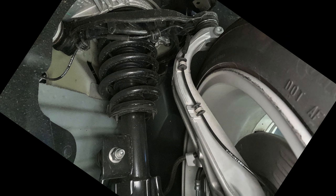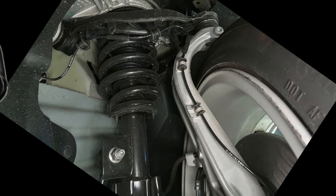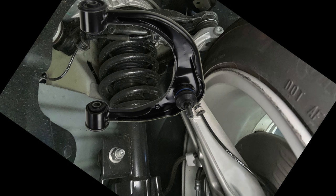The front end is getting new brakes and suspension too. I considered taking the front brakes and suspension off of a Model 3, but the problem is the Model 3 doesn't have all of the suspension arms connected to one subframe in the front like they do in the back. Also, they have this thing with the upright where it curves over the top of the tire, which puts the upper control arm really high. That's a no-go for the Jag because it's got a separate fender and hood, so the upper control arm would actually blow through the outside of the car. I thought about cutting off the upper control arm and mounting some sort of lower ball joint, but since I just bought what I needed from a salvage yard, I'm going to do something different.